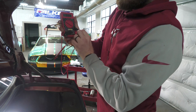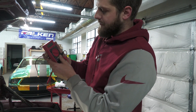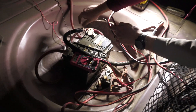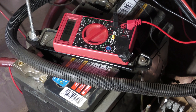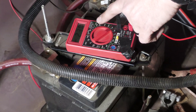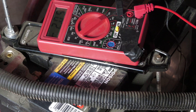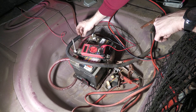So what you're going to do is disconnect the ground. You've got your multimeter here — this is just a cheap Harbor Freight one, but it'll work. Set it to amps. Put one wire into the slot for amps — it says 10 amp DC right there. Put the other one down here. You're going to put one end of the multimeter to the negative terminal of the battery, and take the other wire and put it in line with the ground wire. As you can see on the meter, it's jumping up over 2 amps of draw. That's not good. You want it to be around 0.01, 0.02 at the most. So 2 amps is a pretty substantial current draw, and that's a problem. So now we're going to have to go fix it.